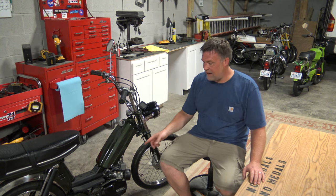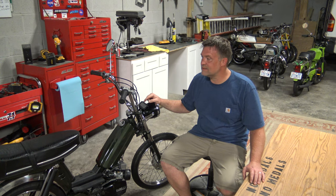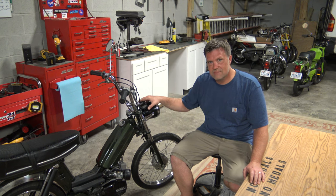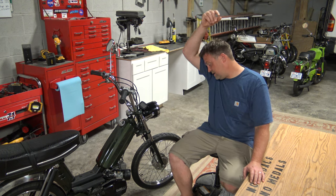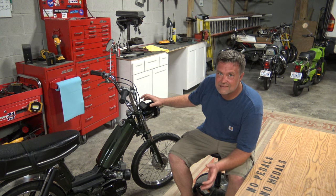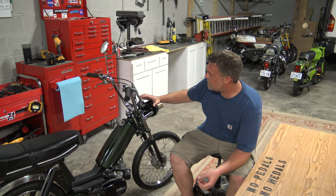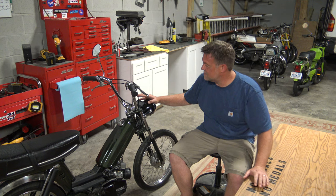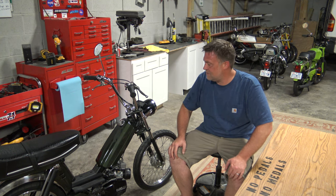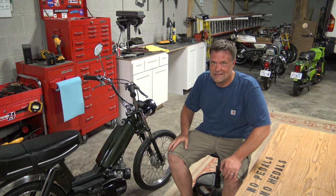First off, things I like: the Trail Tech is freaking awesome. I love knowing exactly how hot my head is and knowing my RPMs. I will say that I think you probably heard me say I was going 46 miles an hour in one of the first test drives — I did that by measuring the wheel and setting the wheel circumference, and then it calculates the speed based on RPM. But when I used my GPS on it, this thing was running about three miles an hour fast. So I ended up tweaking the settings to align with my GPS, and right now if you saw that speed run I just did, it was at 43 miles an hour. I think that's as fast as this thing's going to go.